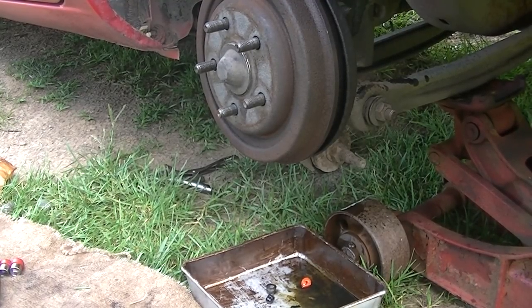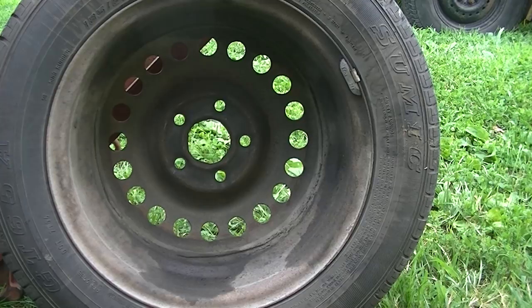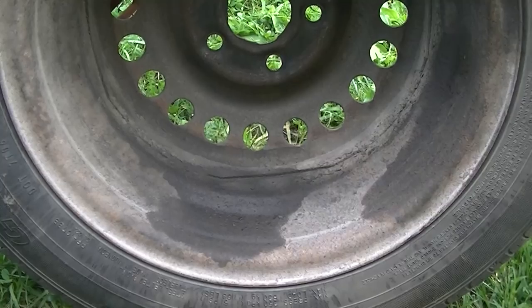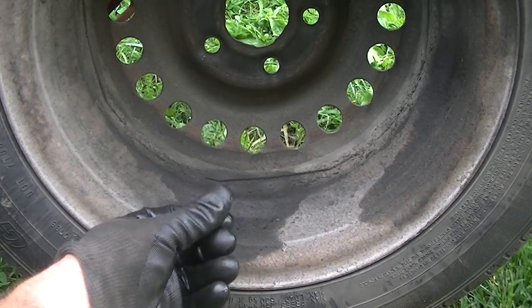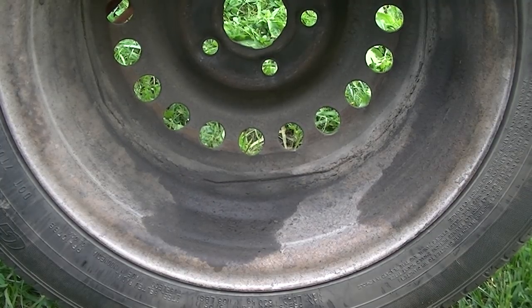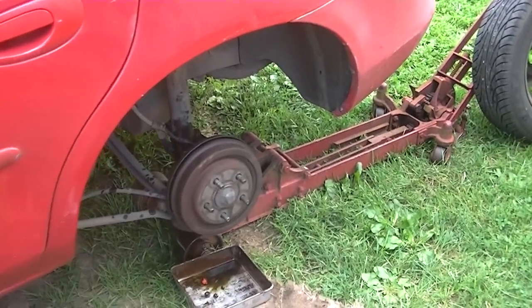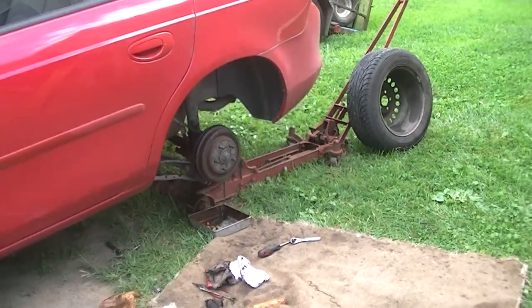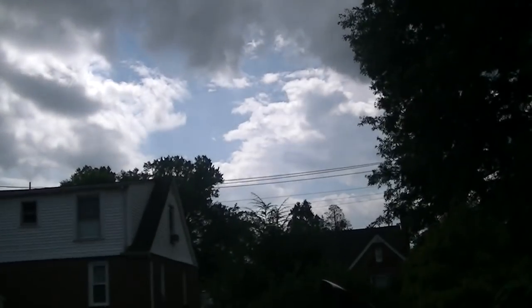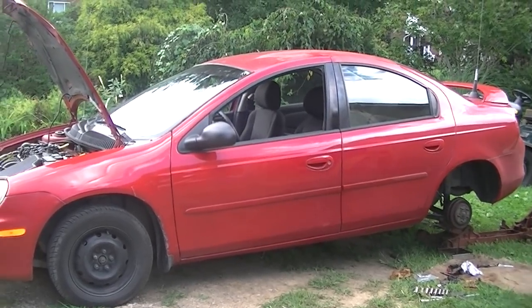I hope this helps you guys out. If you have brake problems, here's a quick tip: you don't always have to take the tire off. Sometimes you can see the inside of the rim — just look on the inside of the rim. If you see a wet, oily spot, you probably have a wheel cylinder leaking. Get it fixed before an inspection because if they see any fluid leaking they will not pass it. I'm not going to bore you with putting the wheel back on. If you like my videos say hello, and until the next video I'll see you guys later — have a good one!